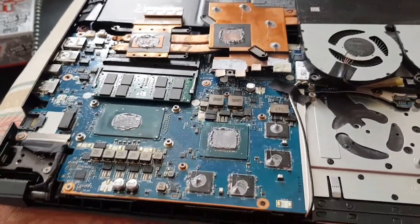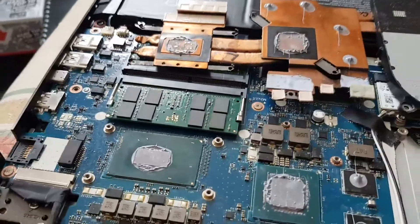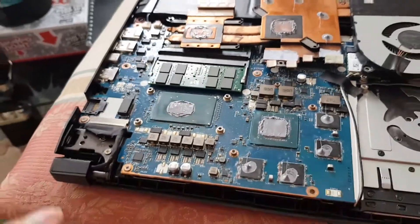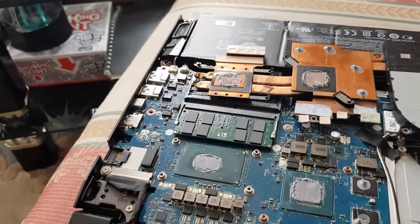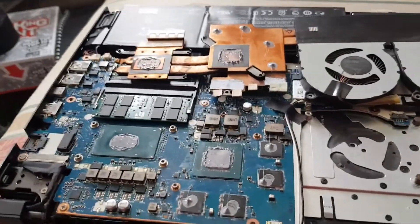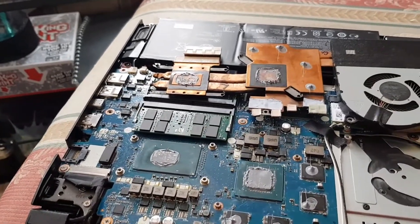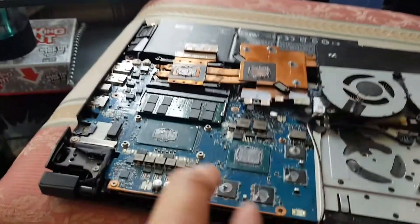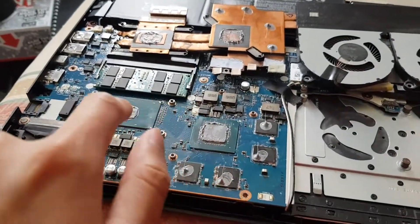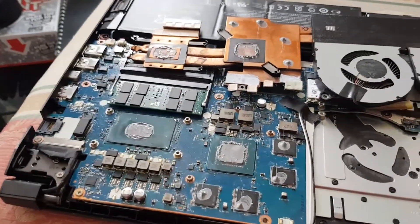What I recommend is: put a dot in the middle, spread it around evenly, then flash a torch — any torch will do. You want to make sure you can't see any metal. If you can see metal, add a tiny bit more paste and spread it around until you can't see it. First clean everything, then do that. So guys, the dot method failed — don't do the dot method. Do the spreading method. On a PC the dot method is fine, but on a laptop it's more delicate and there's more heat, so you need to do it properly with spreading.